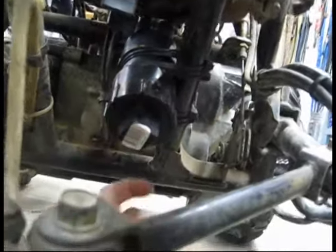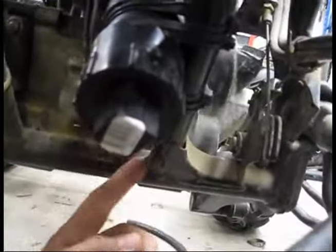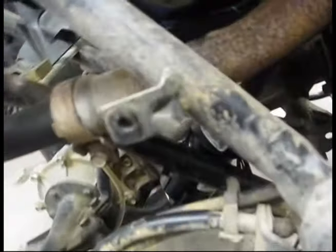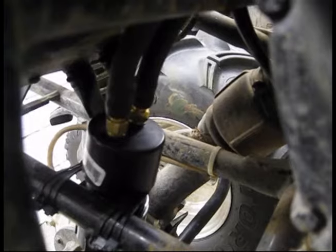The factory original had the T, and the pipe came down and strapped to the back of the engine right in here and just drained straight to the ground. But of course we can't have that if the bike's going to be underwater, because the water would run up the pipe into the top of the motor and then you're flooded — in your crankcases anyway. So to ensure that airflow would go that direction and stuff would drain that way, I had to run a second pipe back out of that reservoir back up the frame, kind of strapped alongside the other pipe so it's held off the exhaust pipe. There's your two pipes, and then it runs back up and straps to the hoses going back up to the vent lines.